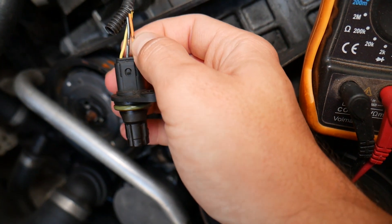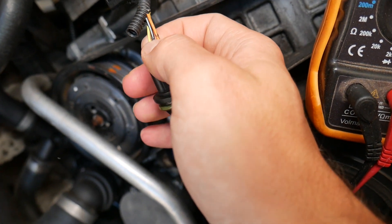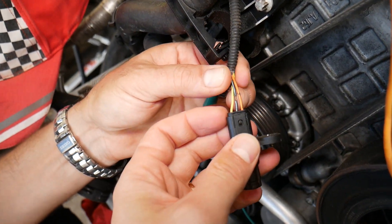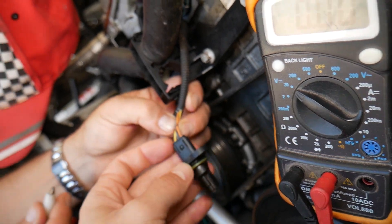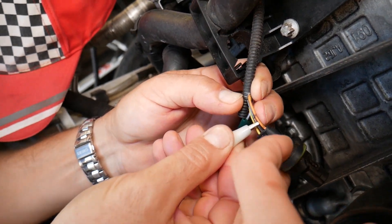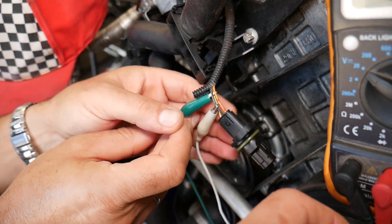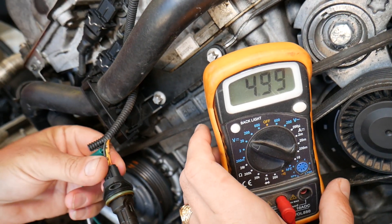If you test the black and the orange wire with the ignition on, you'll get a 12-volt reading — or close to 12 volts, whatever voltage you have in the battery. If you test the black and yellow wire, that's the signal wire going to the engine computer, which should read 5 volts. We've peeled the wires slightly — there are special tools for this, link in the description. Install alligator clips on the peeled wires. Make sure you don't touch both wires together, as you can short a fuse or cause damage to the electrical system.